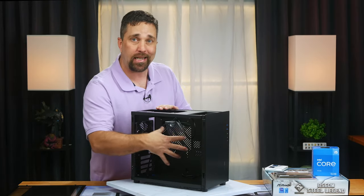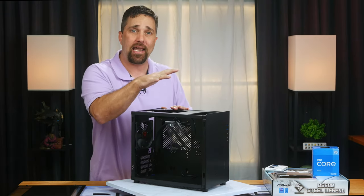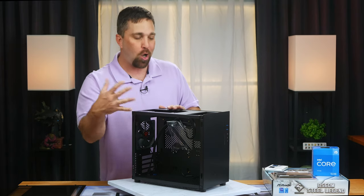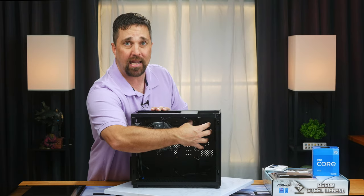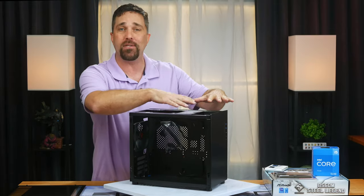As the giant Noctua heatsink heats up the air in the case, that heated air will rise out of the top of the case and cool air will be drawn in from the bottom of the case. Natural convection. Also, the PSU mounts here in the front top of the case, so it won't interfere with the convection and can use the same convection to keep itself cool.